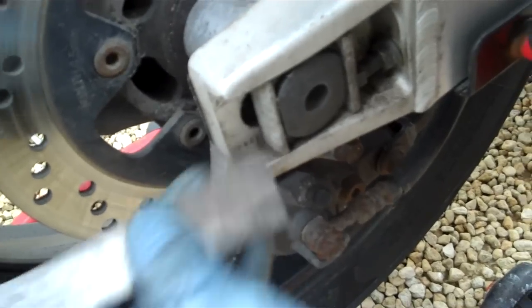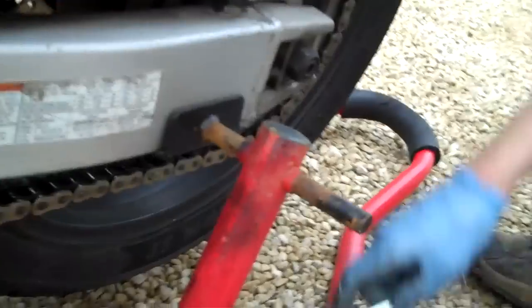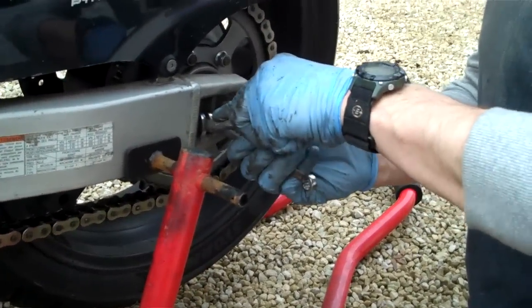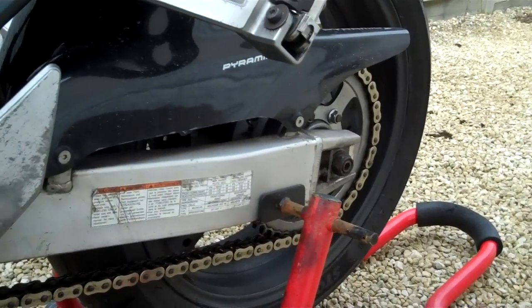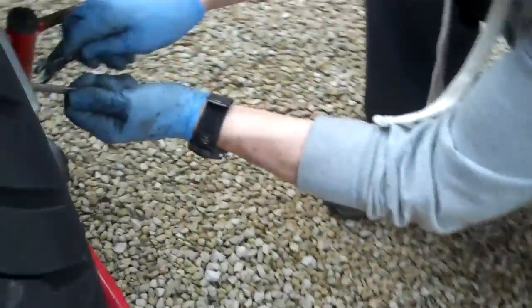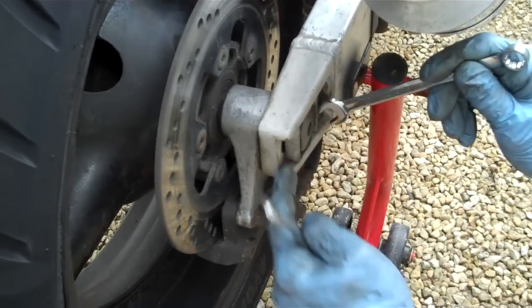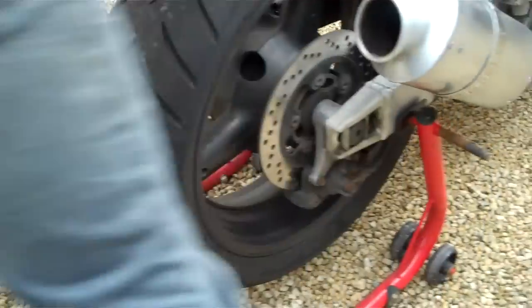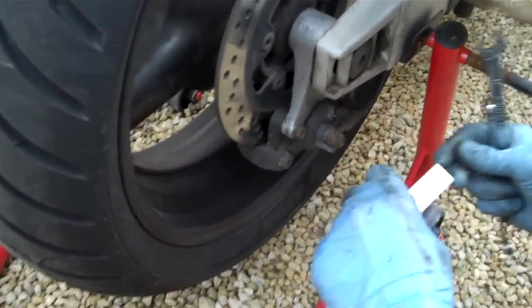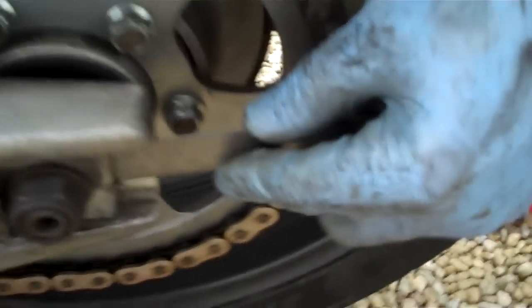15.5mm. Get a proper ruler — not a kids' homework ruler. 15.5mm — half a millimetre is a perfectly acceptable tolerance. Come around the other side: exactly the same, 15.5mm. So that wheel is now perfectly aligned. You can go one stage further and use a laser wheel aligner — you can even purchase such an animal — but use what you have, there's no need for fancy tools. Do up the adjusters both sides, gently. Every time you make an adjustment, check that ruler setting again because it can move. Knit those up and they're tight as they're going to be for riding. 15.5mm both sides — perfect.